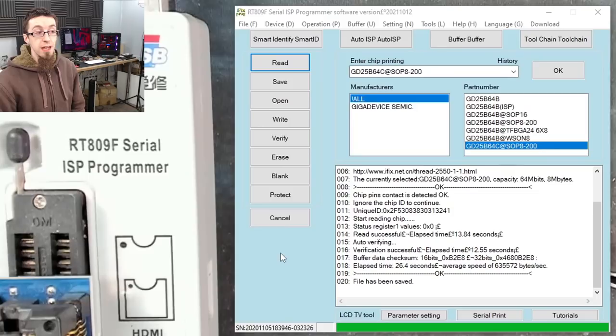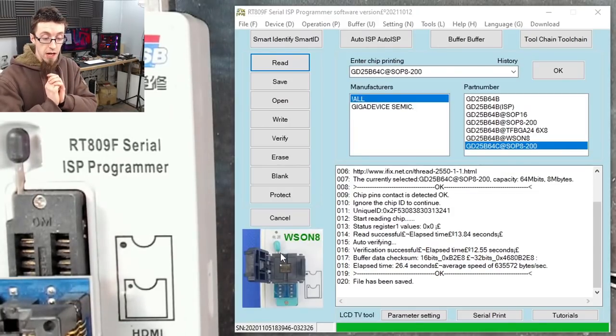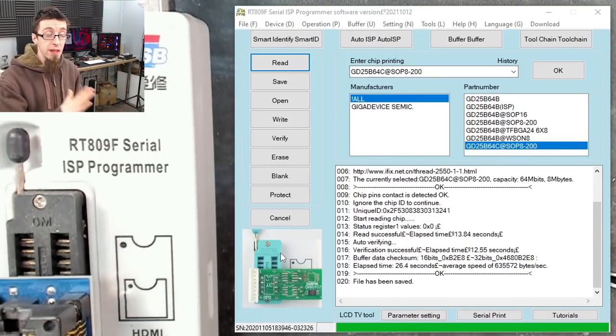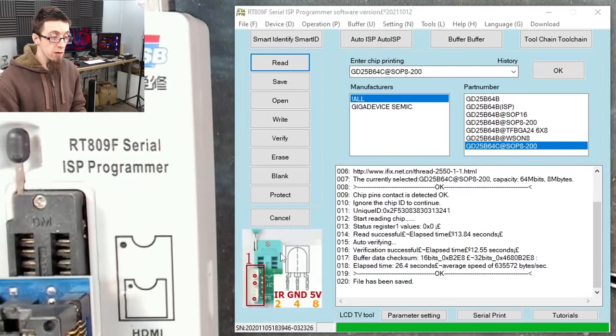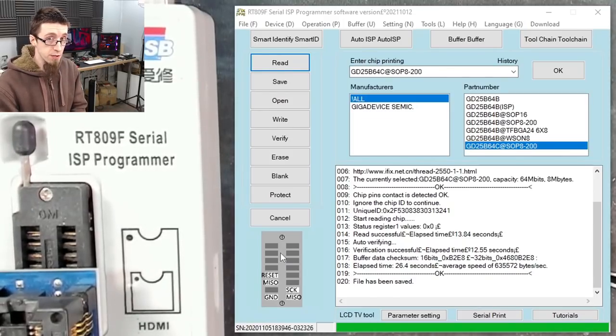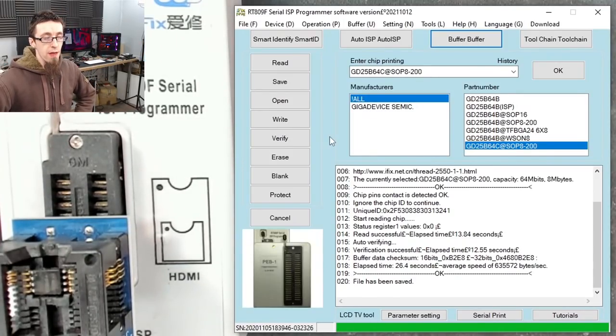It's super important to save the contents of the chip as a backup file and don't touch it. If we do any modifications at all, we're going to copy that file and work on the copy. If we make a complete hash of things, the worst case scenario is we can just reprogram the chip with the original file — put everything back to how it was before. So now we've got a dump of the BIOS, we need a known-good BIOS.